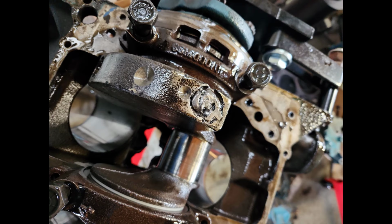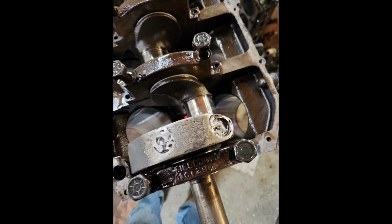So the engine ended up coming out. We tore it down. That was in the next video. Found some sketchy stuff going on with the rebuild. Weight welded into the crankshaft, trying to balance it. It was already 30 over. Didn't have a whole lot of miles on the rebuild. In fact, the flat tappet cam and everything was broken in nice and in really good shape. We ended up reusing it.